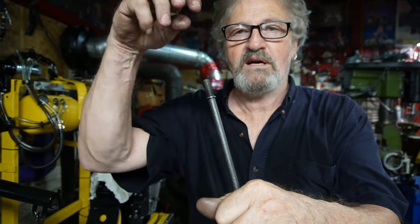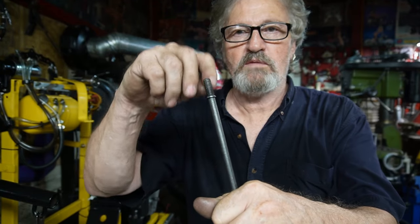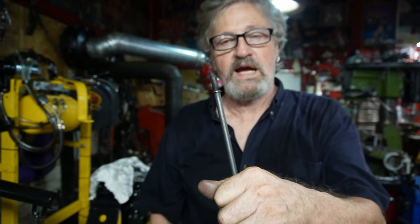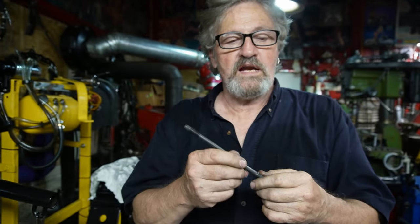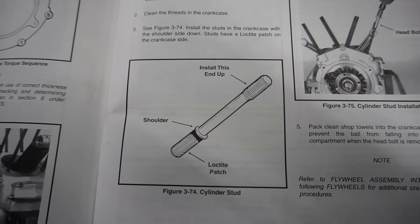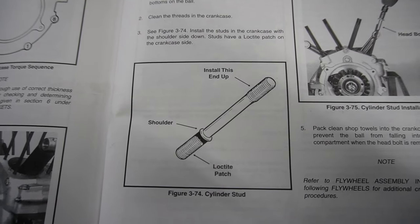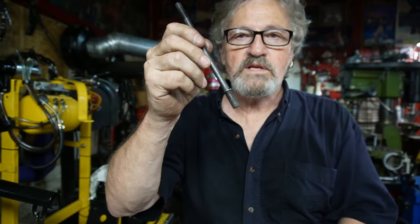There is a chance of your head bolt going down and bottoming out on this even when you're trying to torque it if the lengths are not correct. In '95 they changed them — same studs, same cylinder studs — and they changed them so now this shoulder piece goes down against the case.